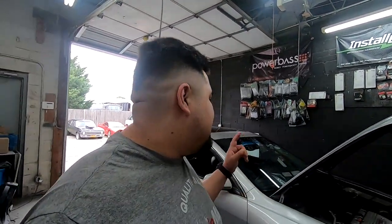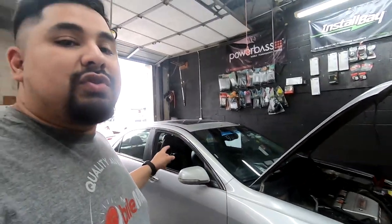Today we're going to be finalizing the DIY Pro Series on our 2004 Acura TSX. We are going to be installing a 6-channel amp and a mono block into our TSX. We're going to be putting them in the trunk. Our system is going to be probably around 800 watts total, so we can use the factory alternator.